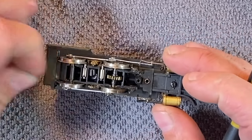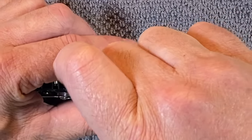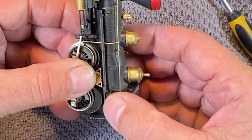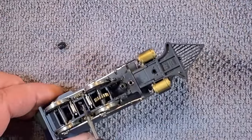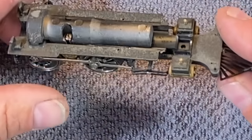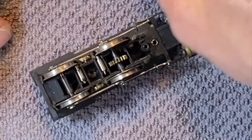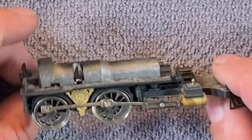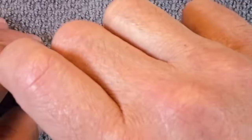We've got some pickup plungers here working on the inside of the flanges. I see some dirt in here and the steam box body is filthy. I want to put it under soap and water but we've got to get everything off first. Something just fell out - right where that screw goes, the plastic is completely falling apart. This plastic is crumbling and I believe this happens from petroleum lubrication being put on the plastic, which then causes the plastic to degrade.